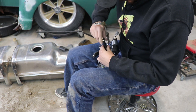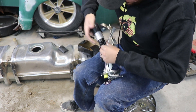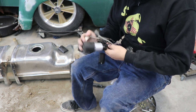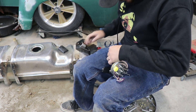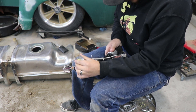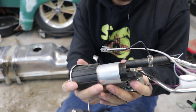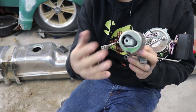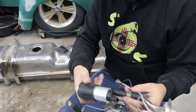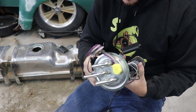We'll get our hose clamps on top of it right away. I'm going to insert our fuel pump — it needs to go up a little bit, so I might need to cut this hose or shove it up a little harder. That's pretty far up there, looks like we're about good. There's our fuel pump mounted; the opening for our fuel filter strainer will get mounted on the bottom. I'll tighten these hose clamps down, and I will have to wire our fuel pump into the existing wires on the assembly — there's just a positive wire and a ground to add.